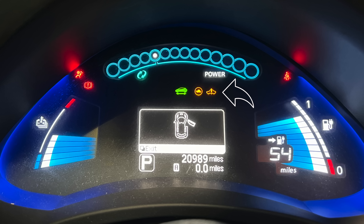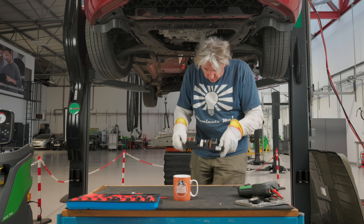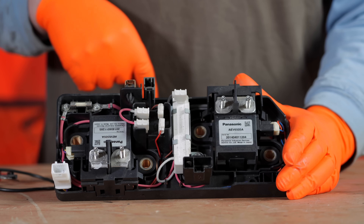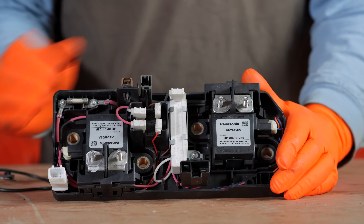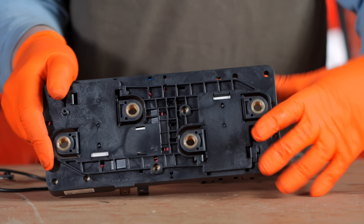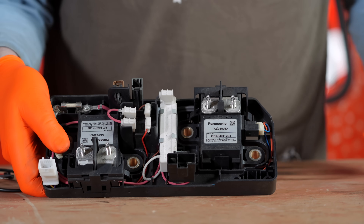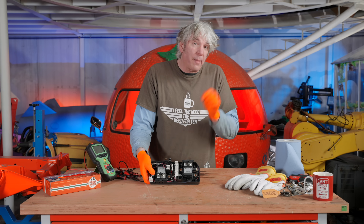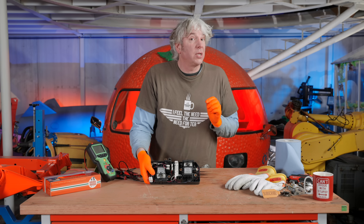That's what drives the error on the dashboard that we had to fix by changing the whole unit. In the episode, we saved thousands of pounds by replacing just this £200 part, but potentially we could have saved even more by replacing just the individual contactors, because they do seem to be a separate product with a separate part number, held onto the base plate by little plastic tags. I'm going to try and get that off, and if we can get even further inside, hopefully we can actually see the contactors — it might involve a hammer and chisel or a saw.